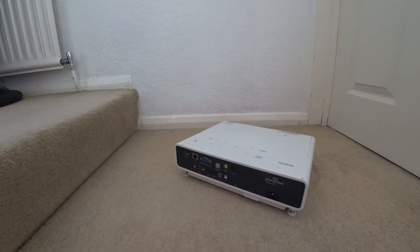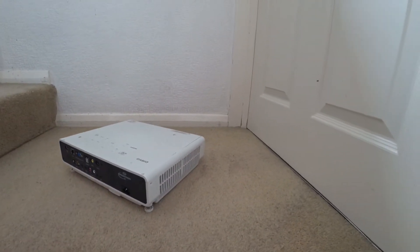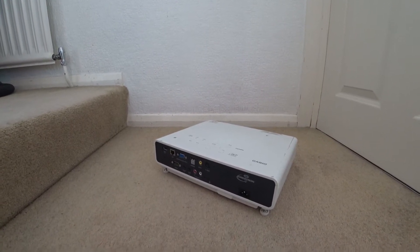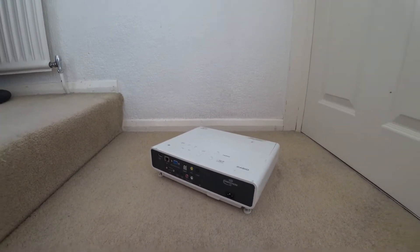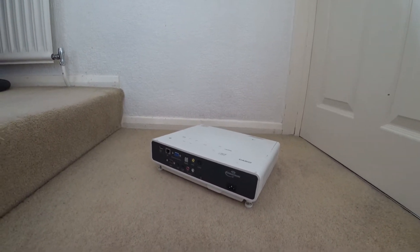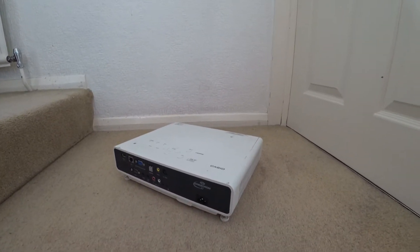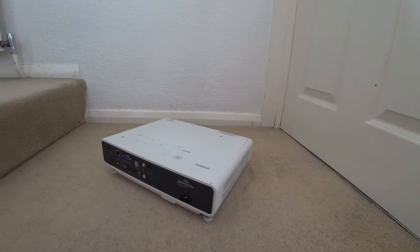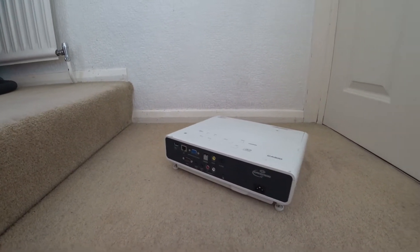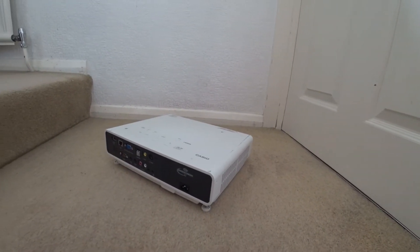I hope you enjoy this video. If you do, please subscribe, and perhaps let me know if you think it's worth me opening up the machine again to replace the pad situated between the heat sink and the DMD chip. I've left the original one in place, but I've read that it may be wise to use a new compound - some CPU Arctic Silver compound - to make it last a bit longer. Let me know your experiences with that.